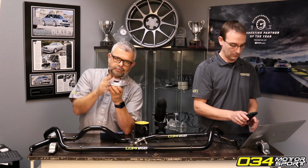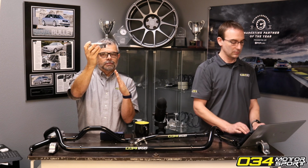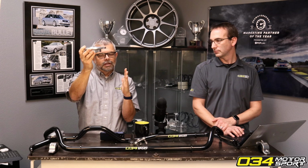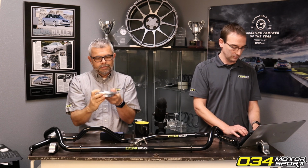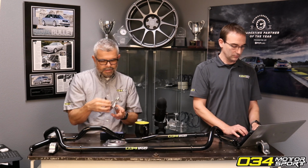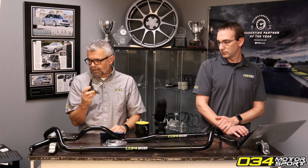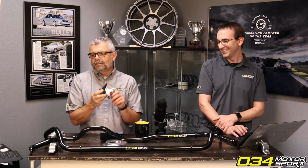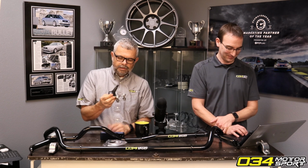So you can do that, and the benefit about this is when you do this, it moves the top of the tire in. So if you're having any kind of fender lip clearance issues, this helps that because it moves the top of the tire in away from the fender, towards the center line of the car. Then furthermore, on GTIs, Mark 7, Mark 8 GTIs, and Golf R, and S3, yes, it fits. It just doesn't fit TTRS. So pretty much everything is covered.